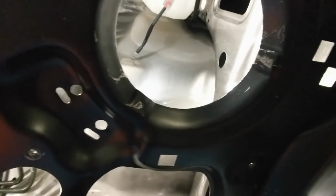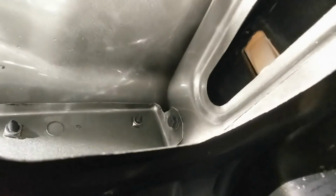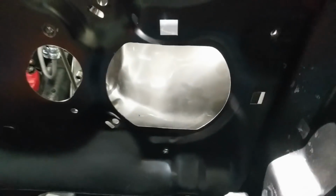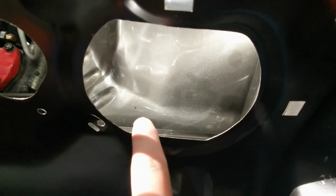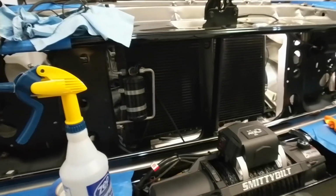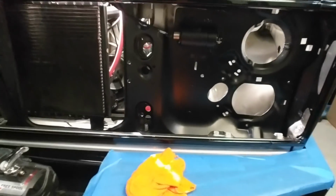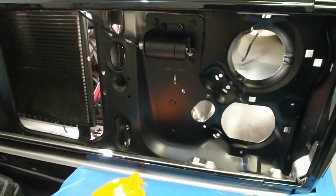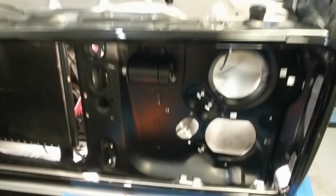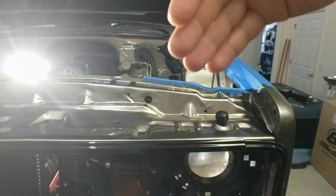So now I'll peek in here. This stuff I'll start to sand down. Can you see it, in there where the paint is coming off? Little spots like that one, I'll go through and wet sand those. That way I'm just wet sanding the clear coat. Of course there's some metal in some places, but I'm doing that now so I can come back when I get the airbrush and hit all the spots, clear over them one more time, and hopefully get everything from just about the bottle forward done.